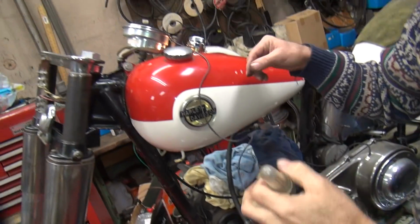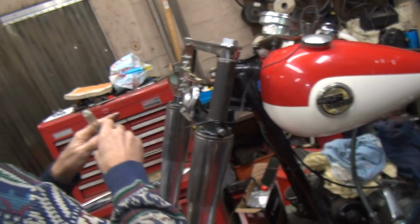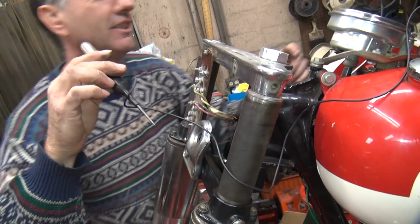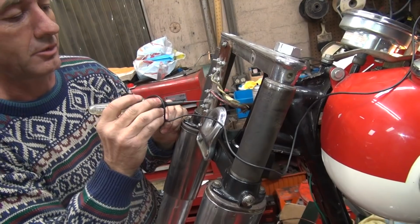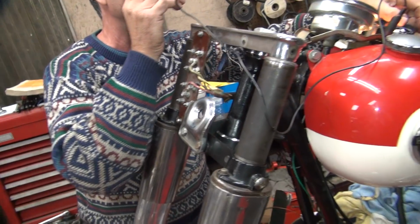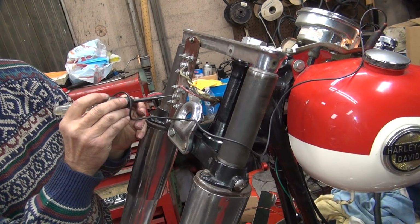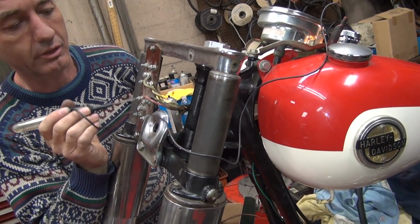It's warm. Okay, now we go back up to the front of the bike. Turn the switch off. Notice how we have no hot wires anymore. That is what we're looking for. Now you go to ignition. No hot wires anymore because there's no ignition up here. Okay, now we go to our light circuit here. So there, the lights are now on. So no light, no light, no light, no light. Now that's not correct. We should have power right now to these things, which we do not.